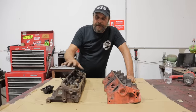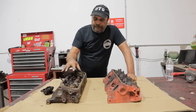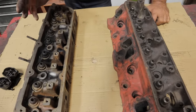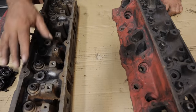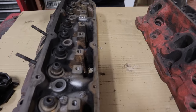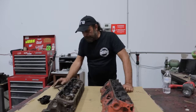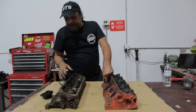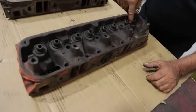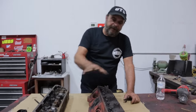The Magnum uses a beehive-style valve spring; the LA uses a conventional-style spring. The guides are approximately the same, so from stock you can get approximately 540–550 thou lift before the retainer hits the boss. If you prep a head, just take about a hundred thousandths off the top of the guides and you'll have more than enough valve clearance for almost a 600-thou lift cam. They take the same style spark plugs. Valve covers are different — the LA uses five valve cover bolts, the Magnum doubles that up. You can take LA valve covers and bolt them on a Magnum, but not the other way around.